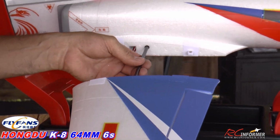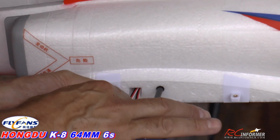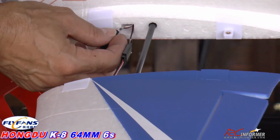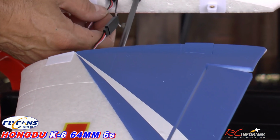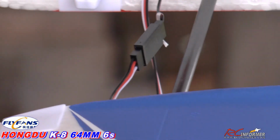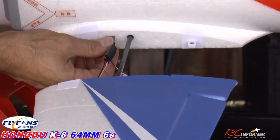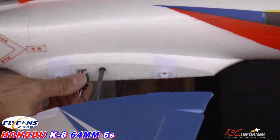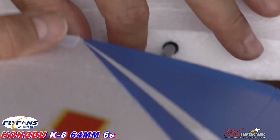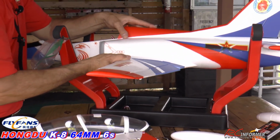When I was competing in Top Gun a couple years back, Jerry McGee was flying his MiG 29, and he had an instance where his landing gear stopped working on him right before he was getting ready to go fly. We started looking through stuff, and I said, wait a minute, check your connections. So we pulled all his connections, and a lot of them were loose. So I grabbed my hobby knife, tightened all his gear connections, plugged them in, and the gear started working fine. So sometimes you just have one little link that's bad, or not a good contact, and that's the end of your day. If that's on a speed controller, or if you have a single elevator servo, for example, and that goes bad, your plane's probably going to be going down.